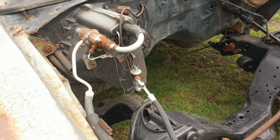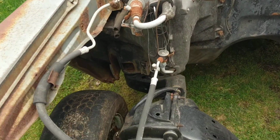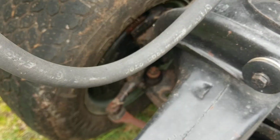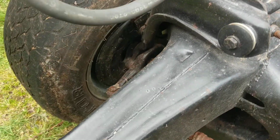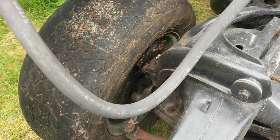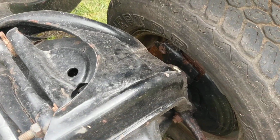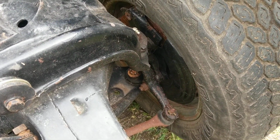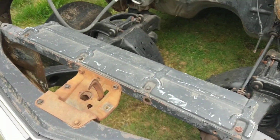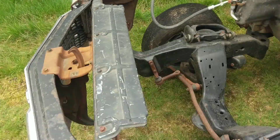It was an AC car, as you can see the AC box is still there. It does still have the disc brake spindles and backing plates and rotors. The calipers are not there, but those are $25 parts store items, pretty easy to source. It has a 4-bolt top plate across the top from the V8 radiator.